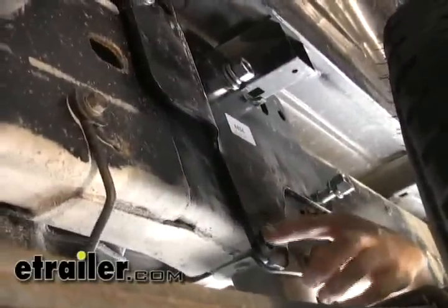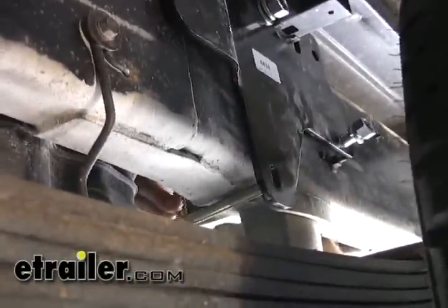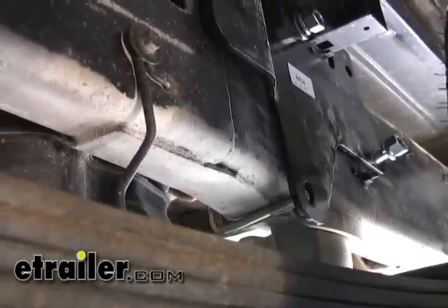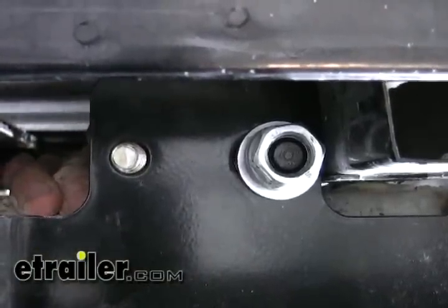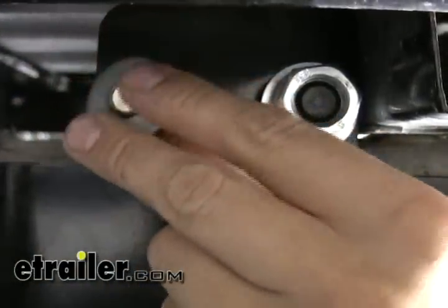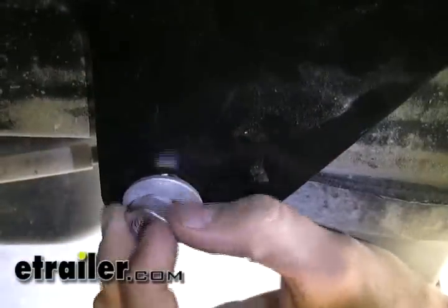The holes we'll be using on the frame bracket are the one at the bottom and the middle one at the top. We're going to insert the U-bolt from the inboard side back out through these holes, and you want to make sure to avoid pinching any wiring harnesses or brake lines while applying the U-bolt. We'll attach the U-bolt with a conical tooth washer and hex nut, tightening down a little until we get the one on the other side installed, then come back and tighten everything down.